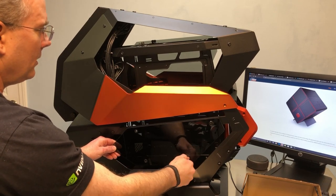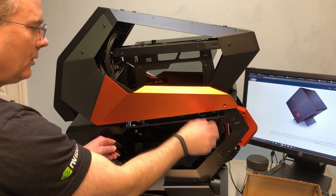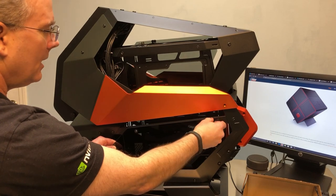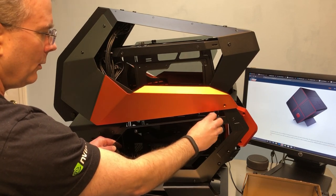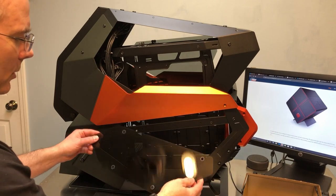When you take those panels off, there are little rubber grommets in there and it's pretty thin glass. They help isolate any vibrations so your glass doesn't rattle. Plus when your fastener tightens down you really don't want it tightening directly against the glass — it really tightens against that little rubber shoulder. A couple of these fasteners were pretty tight; I really had to crank on them with a screwdriver to get them out. All the work you would do to your system you would do with the chassis removed, but it's nice to be able to remove these side panels if you need to get in there for something.